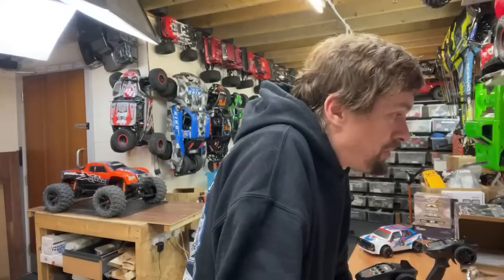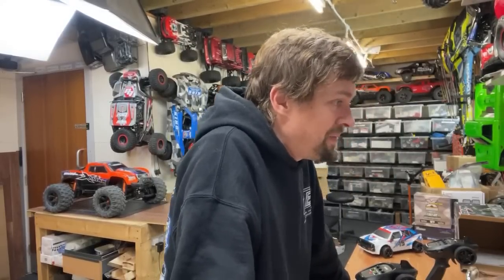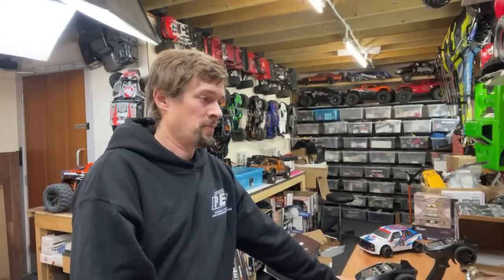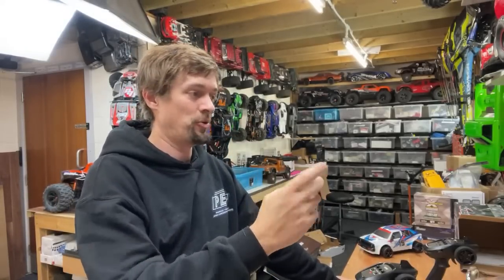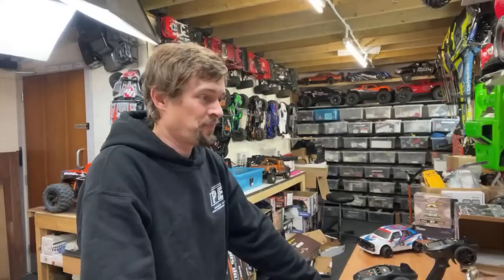What engine have you chosen for the monster truck, says Ainsley. Big block Chevy, alcohol supercharged, running at around about 1500 horses. If we put a smaller supercharger pulley on the supercharger side, or a bigger one on the crank side, that's going to overdrive it, and we should be able to push it up to 2000. But I've been chatting with Tony, and he reckons I could probably get it up to about 4000 if I put a bigger supercharger on it. But I was thinking of, you know, when we do shows, you're not allowed to run too much power.